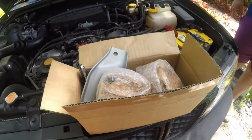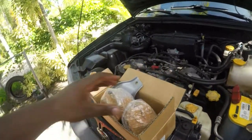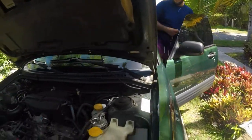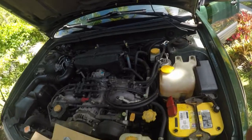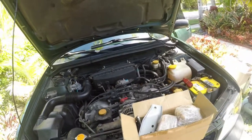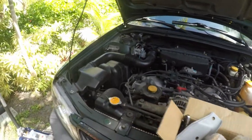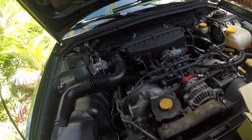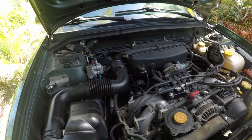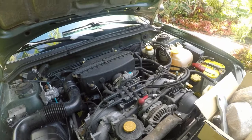When I had originally bought this car, the previous owner had given me some new motor mounts because the old ones were going bad. Let's start her up and see — the engine's supposed to shake upon startup, I mean obviously that's physics, but when driving it's a little too much vibration coming from the motor mounts. The axles are going bad too, so that's gonna be a later video.